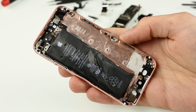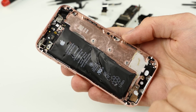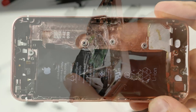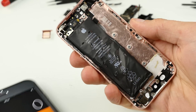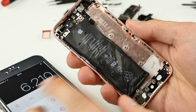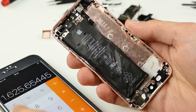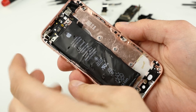Alright, here's the teardown of the iPhone. The battery is not compatible with the iPhone 5 — it has a different shaped connector, as you can see right here, and you can also see it from the inside with that green connector. The capacity is a little bit bigger: it's 6.21 watt-hours. If we calculate that — 6210 divided by the battery voltage of 3.82 volts — we get 1625 milliamp-hours. That's the actual capacity of the battery.